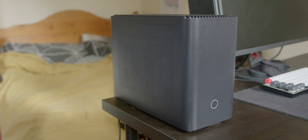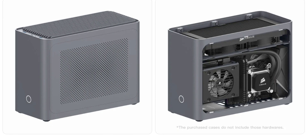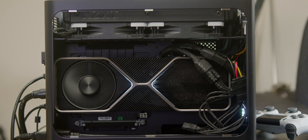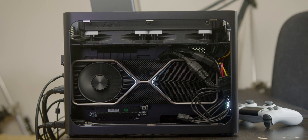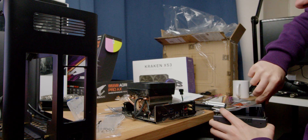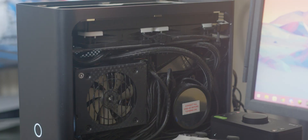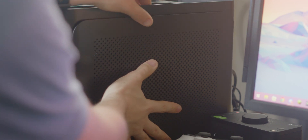Let's briefly go over the case and the layout. It's a black water-cooled model, meaning it has a taller top portion compared to the rest. There's enough room for a mini ITX motherboard with one two-slot expansion card such as a graphics card, an SFX power supply compacted inside with an extension cable to route the plug to the rear of the chassis, as well as a 240mm liquid cooler at the top. My only drive is an M.2 which sits on the board itself, so it's not mounted anywhere in the case.